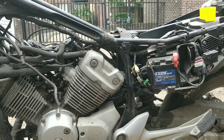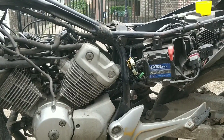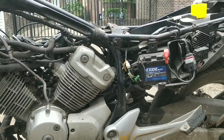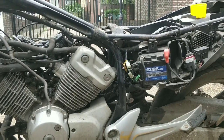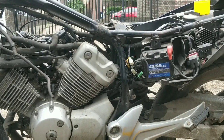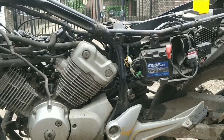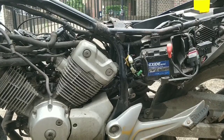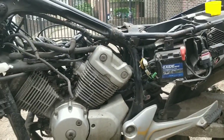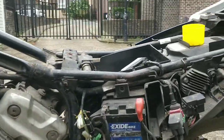For now I'm going to unhook this battery, hook up my Suzuki Bandit battery, chuck in that other CDI, and see if spark comes back. We know at the moment this bike does not spark on either spark plug. We traced it all back - the wiring seems okay in places, it looked a bit touchy but was cleaned and checked. There doesn't seem to be much reason why it wouldn't spark, so let's chuck that on and see.